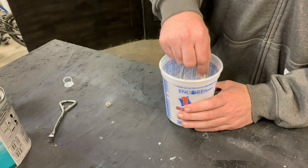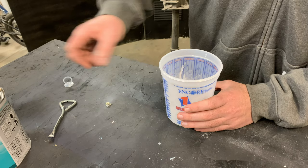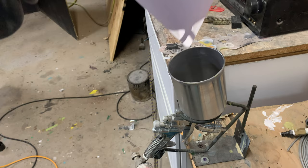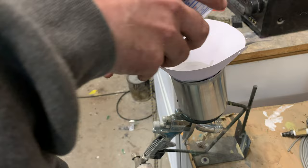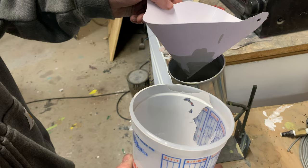I'd rather have it a little thicker, and if you use a priming gun it has a little thicker needle in it. You go to any store when you buy your paint gun and they can hook you up with the right kind of priming gun. Now I'll show you what we do next — put your strainer in and strain the primer. Being a new primer, we probably won't have any issues. Sometimes there'll be stuff in there you want to filter out over age — it can get clumpy. You stir it real good; you really want it mixed well. You want to strain it into your gun cup.